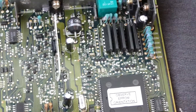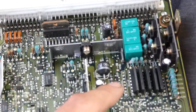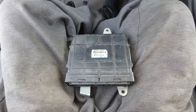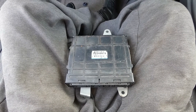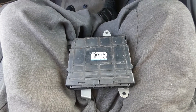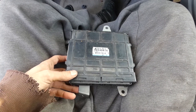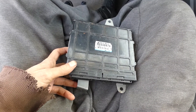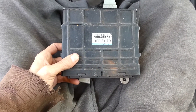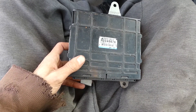Just check that out when you're looking at anything. Also look for anything burnt — these little drivers here can get burnt, and these MOSFETs can get burnt back here. Now we're on to the third type of ECU, which is completely different than the other two — this is the black box. The black box is very similar to an Evo ECU, but it just has some differences that make it so they're not directly compatible. These are actually a little more desirable, and they came in basically 98 and 99 cars.